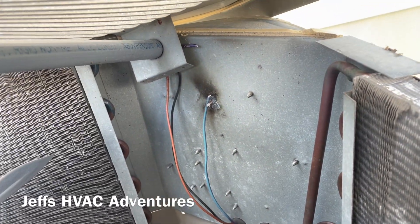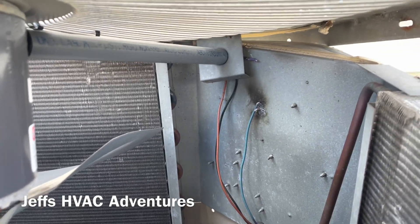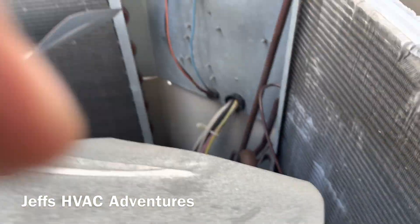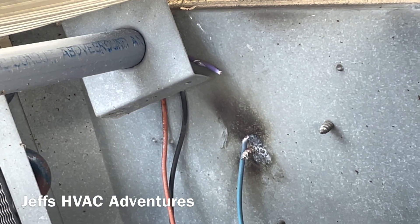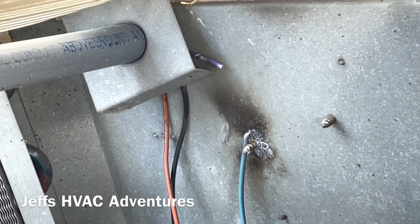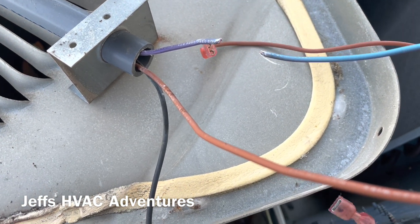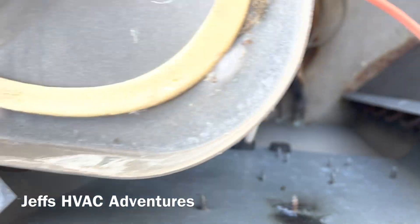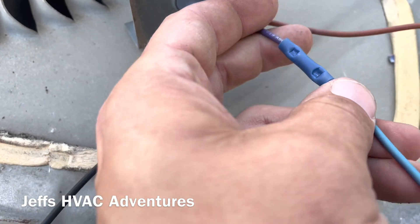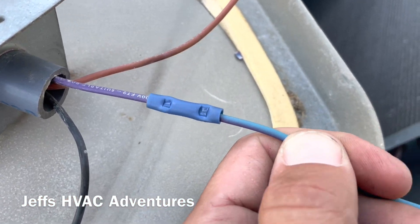As soon as I started to open this up to look at the wiring, I found a burnt-up wire in there. That's probably where our breaker trip came from. The unit actually started and the fan started when I first fired it up - maybe opening the top finished separating the wire. That's definitely where the breaker trip properly came from. We're going to get a splice connector and fix that. Got our connector on there good and tight - had to be careful since we didn't have much wire to work with, but it looks like that's making a good connection now.